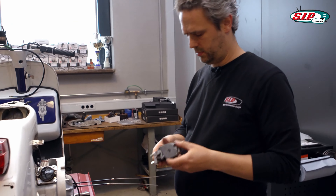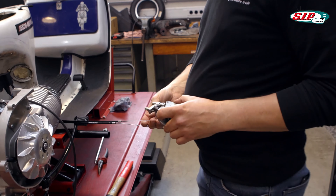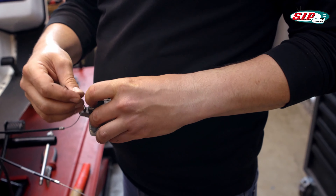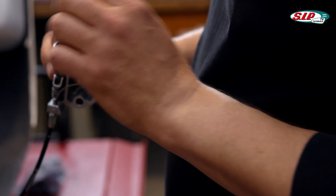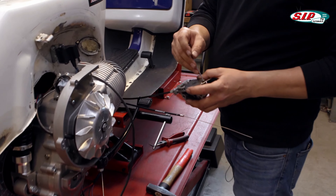Now in idle position. I'm connecting the selector box to the gear cables so I can adjust them perfectly and then only have to slide them on. The SIP Bowden cables are luckily numbered. This is number one — it goes in from below and pulls in my case to the first gear. It's always a little bit fuzzy here, so it's important if you install the Motorino Diablo that you always use new cables. Now it's through and it can be fixed by the grub screw.